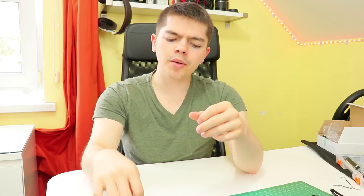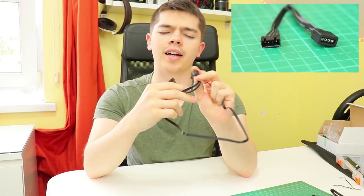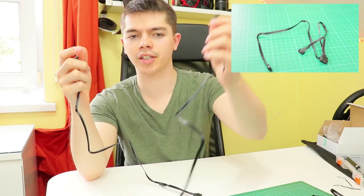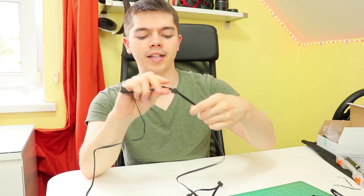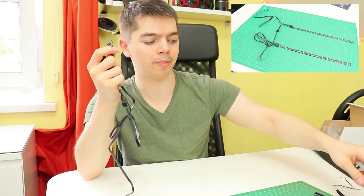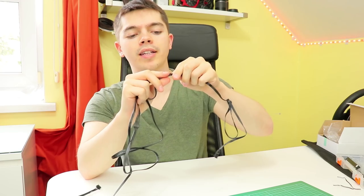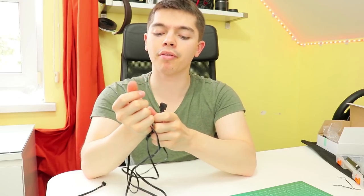So in terms of the motherboard, we do have a couple of cables here. This is a female to a universal female cable or connector, and it also has a male connection on the end of that passing through from there, so the power goes and links all the way through. That's a really interesting cable in itself, because you can add in the other one, which is identical to that. So again, you're looking at a straight pass through, and then you have two universal connectors at the end, and then you have another male pass through, and then you have a final connector at the end here, which they provide, which is a female connector on one end to the male that led off from the previous ones, and then it means you have three universal connectors.